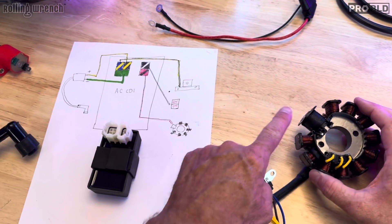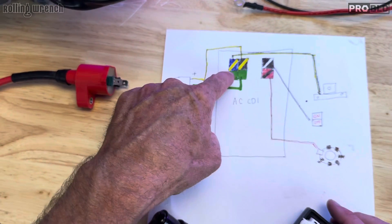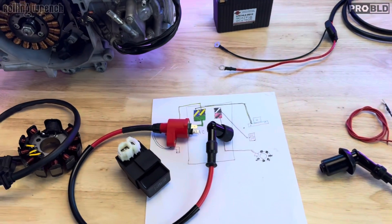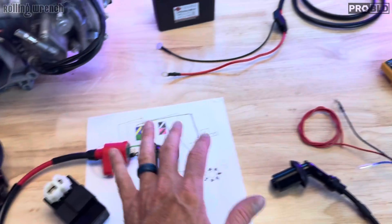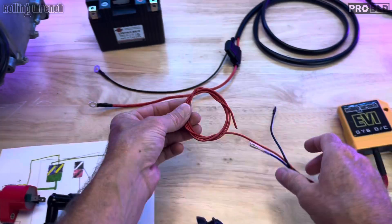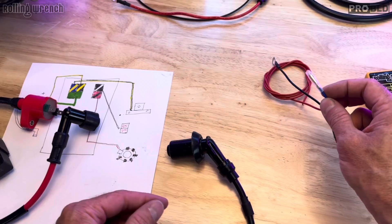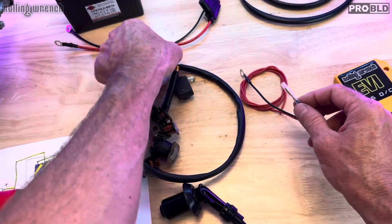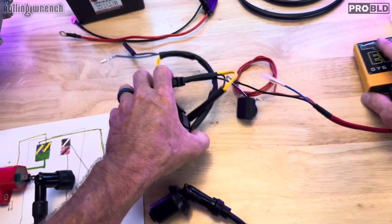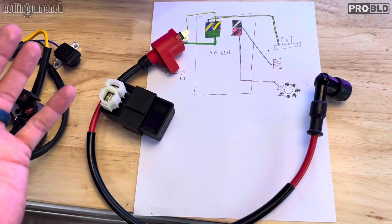You've got a ground wire going to your ignition coil, and a black with yellow stripe coming out of your CDI box also going to the ignition coil — so positive and negative on your ignition coil. Plus one extra wire to power the CDI box. You end up with five extra wires that you wouldn't have on a DC system. So when you choose between an AC or DC ignition system, you're going to choose DC. It makes life really, really easy — power and ground go directly to your battery, and the only other wire is the little blue trigger wire.